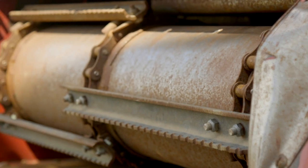The feeder floor is usually a high-wear item. A lot of times if you have excessive wear on your feeder floor, it's because your chain isn't adjusted correctly — it's dragging. Or if you don't run your header at full capacity and don't have enough material going through, it'll wear a hole through there.